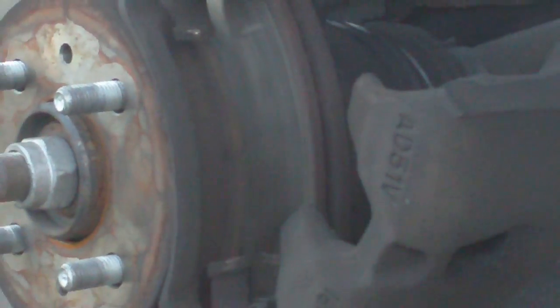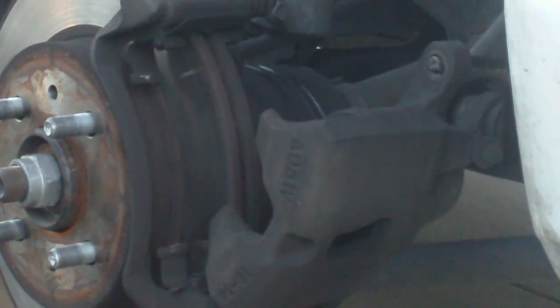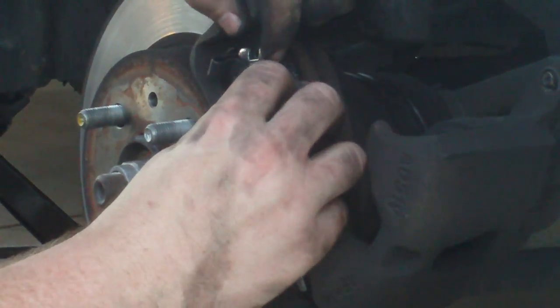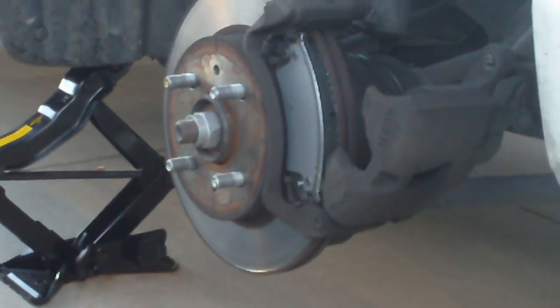There's the back. Oh, the front brake pad, excuse me. Just removed right there. Oh, the front and the back, excuse me. You got them both off. Pretty easy stuff. And all you have to do is loosen the bottom bolt, take the top one off. The new brake pads come like this. He's going to set those in the right, proper alignment. Okay, and they just kind of snap in, no big deal.